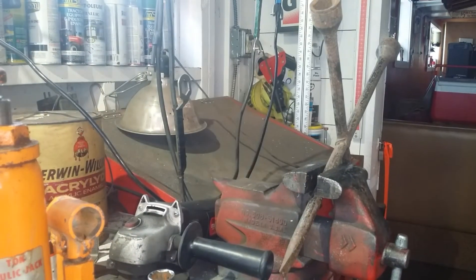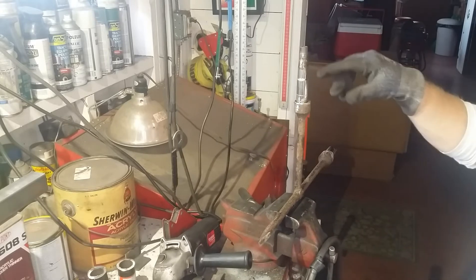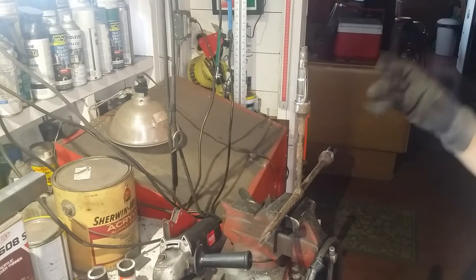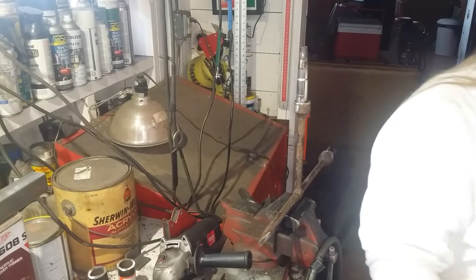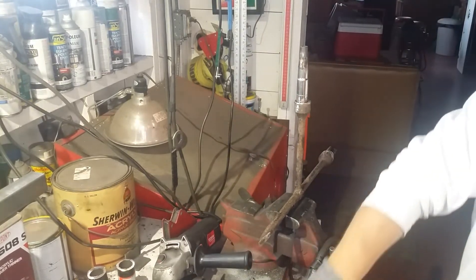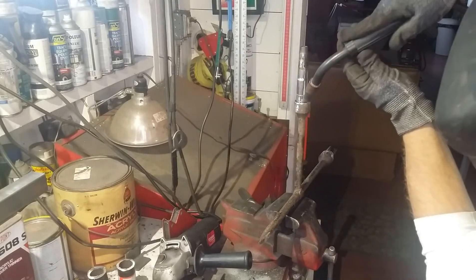It's fall going into winter — this is the time when I hope I have time to build stuff like this. I've got a million projects in my head and this is one I want to get done so that if I need it, it's there. Sometimes when you build it and you have it, you'll never need it, and there's a benefit in that itself. I'm down to the last one: got the socket welded with the groove cut for the jack release, three-quarter welded on, 13/16 welded on. Let's get this last one welded and get out of your way.